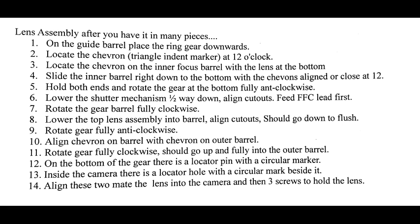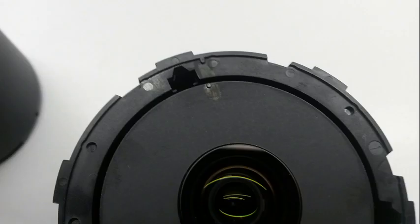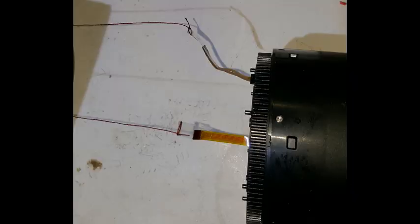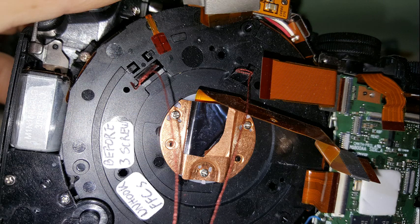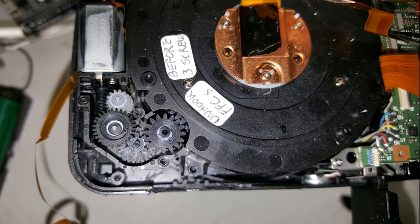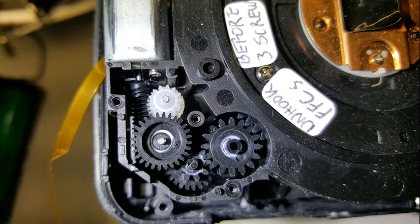To reassemble the lens, there are a few points to follow. There are various index marks to look for. Once the lens body is assembled you have to insert it back into the lens holder — the two FFC leads need to be threaded back through the respective holes. I used two cotton threads with a small piece of sticky tape on the end, stuck to the back side of the FFC. Draw the cotton out slowly as you insert the body into the holder. Line up the key pin between the lens body and lens holder. Insert all three screws and then reconnect the two FFC leads.